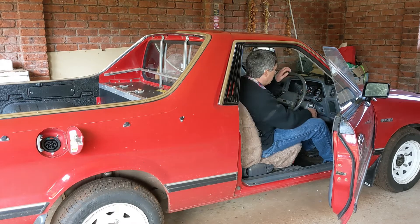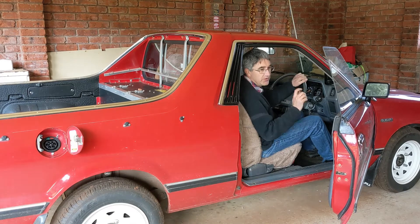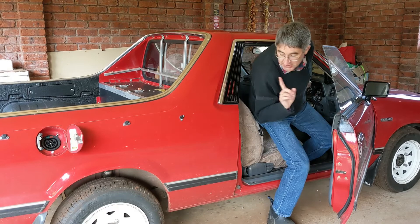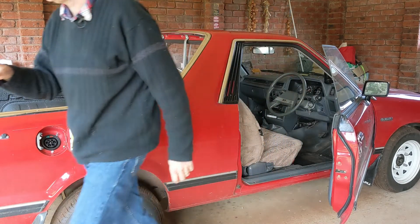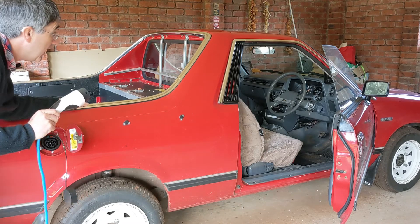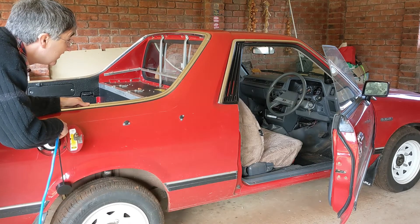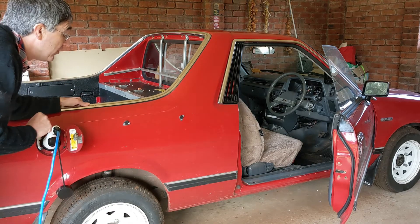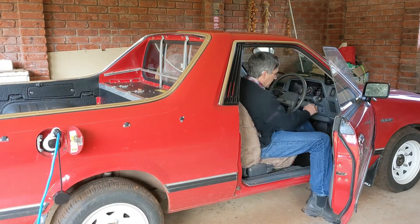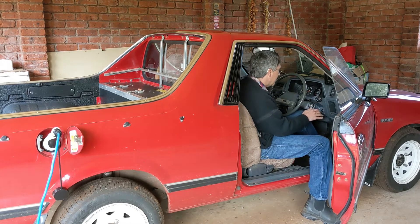This works whether the power is on at the EVSE or not. So the power was on at that stage, but this time I'll turn the power off. When I plug this in, that should stop — there, it latched, so we can't drive now. And I can't re-enable it. Turning the key switch to start does nothing.